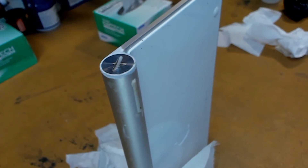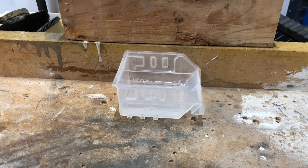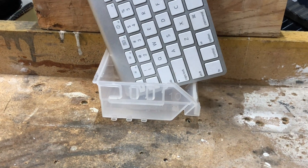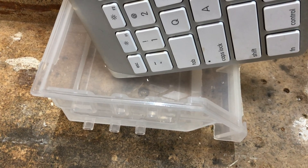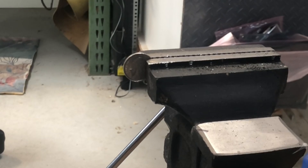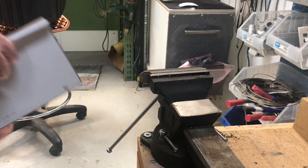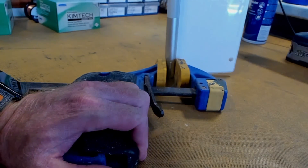If you're lucky and the WD-40 has done its job, just get your coin and turn anti-clockwise. But if it's still jammed, there is another way: make a concoction of white vinegar and a couple of squirts of lemon juice. Insert the battery cap end of the keyboard, making sure this acidic concoction covers the cap but does not go near the keys. Let it soak overnight. The next day, put your opening coin in a vice, engage it in the slot of the battery cap, and turn anti-clockwise — hopefully that will crack the cap.